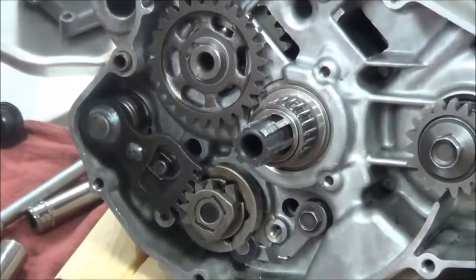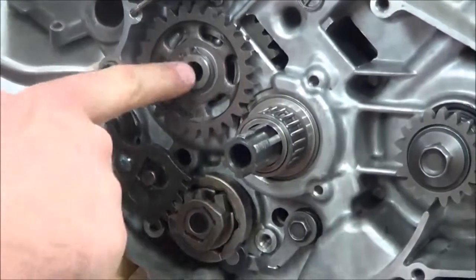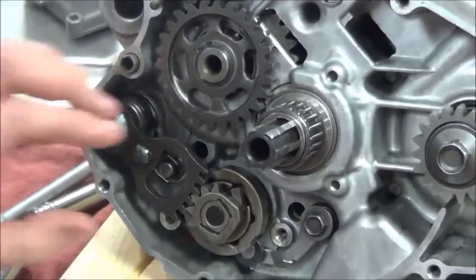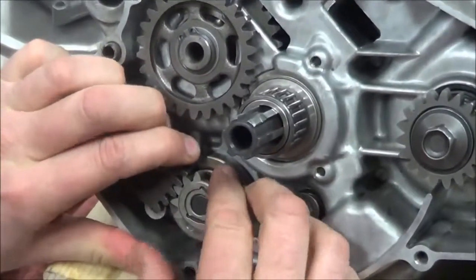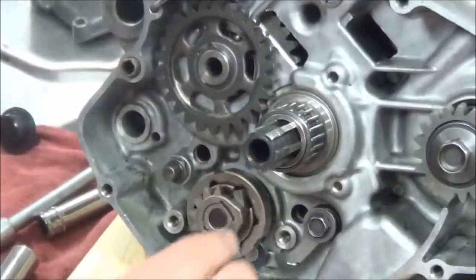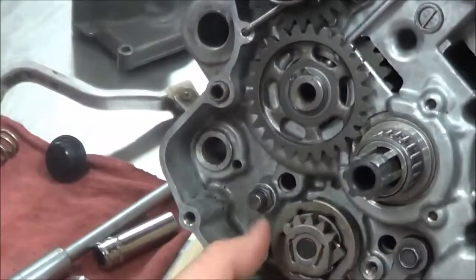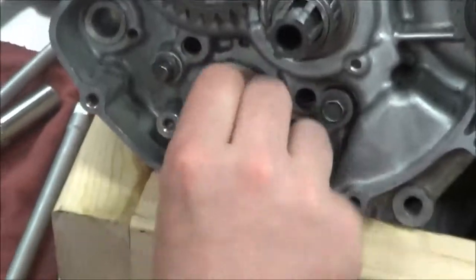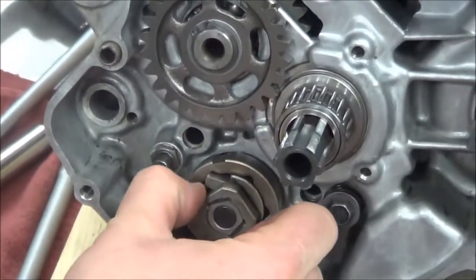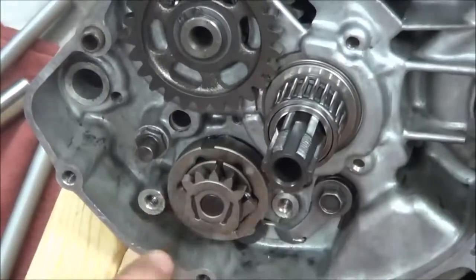You can see how my engine is kind of tipped over, so it's not in constant mesh turning under a thousand RPM where everything wants to roll together nicely. If I hold the countershaft sprocket, you can see I'm actually in a selected gear right now. This is hard to operate by hand - it's easier to pull this out and do proper assembly. But I wanted you to see how this rotates, only about this much for an upshift and a downshift. Going the other direction, this finger will take the drum that way.